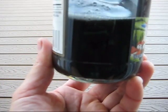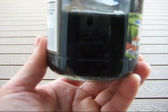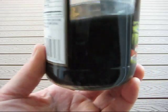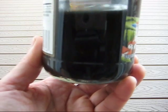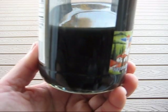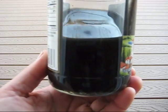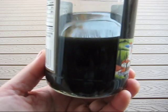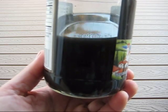That's the amount of dirt and grime and all the lubricant you've put on the chain, all in one bottle. In a day it'll all settle to the bottom, and you'll see the mineral spirits are fairly clear and you can reuse it. I fish out the chain, stick it in another bottle of mineral spirits, shake it up to get the residual dirt and grime off, then wipe it down and nail it to the fence.